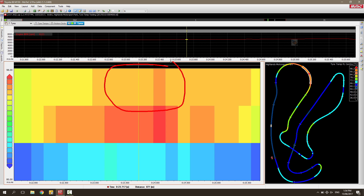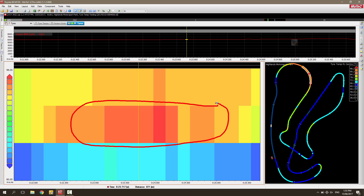At the top we have the temperatures representing the outside edge of the tyre, then the temperatures from the centre of the tyre, and finally the temperatures from the inside edge. We're looking at one tyre and one part of the track — just coming up to the exit of the Southern Loop here at Highlands Motorsport Park. The important point to take away is that we see relatively consistently the centre of the tyre is hotter than both the inside and the outside edge, and that's the effect of the higher tyre pressures being shown in the data.